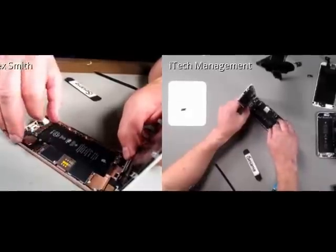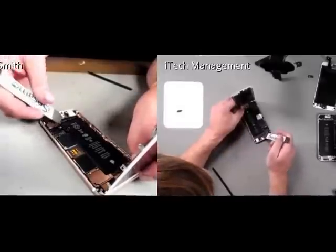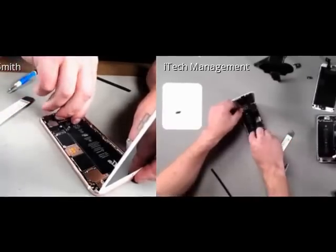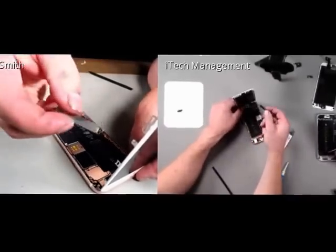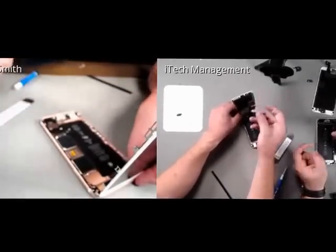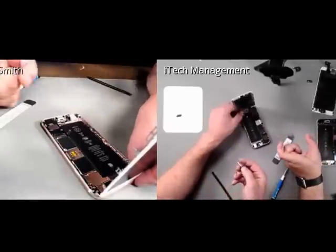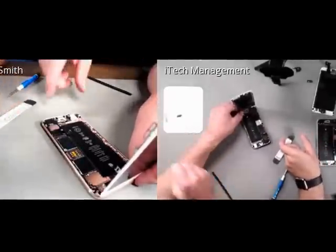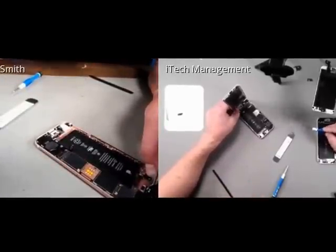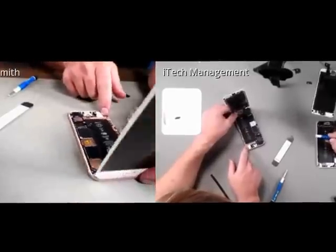Yeah, we should actually do a study on both frequency and size. We'll get a little seismometer for it. So if anybody's curious how the Taptic engine works, basically it's an electric coil that has positive and negative charge on each side, that has a weight and a spring. So when the vibration's set, it just slightly moves side to side, versus the old vibration motors, which actually were like a half moon shape that would spin and throw it out of balance,